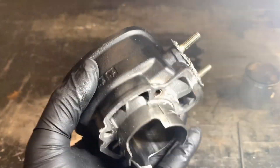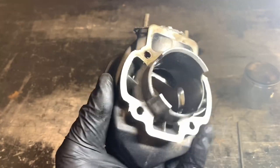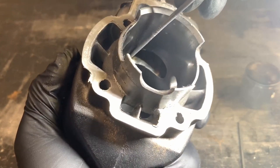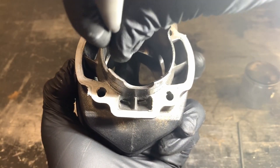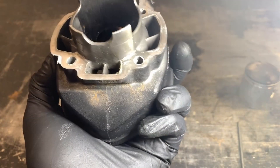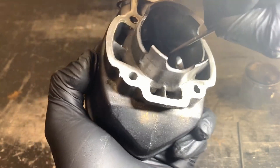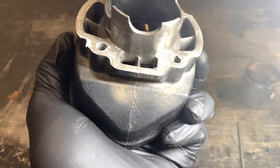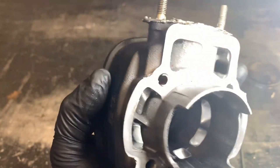If you're doing it on a brand new cylinder, a scratch is not a very nice thing to see. I like to go around and do all the top ones first, then flip it and go through and do all the bottoms. Same thing on the bottom — maintain a nice angle, roughly 30 degrees, all the way across. For the exhaust port, you don't need to get the sides; you only want to go to where the radius basically starts to be vertical, in line with the direction of piston travel.